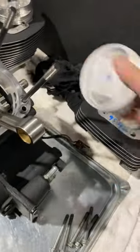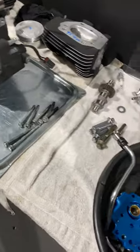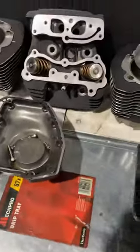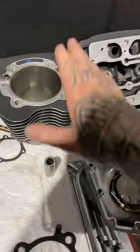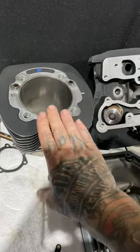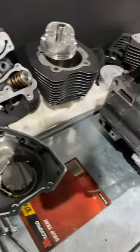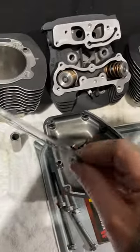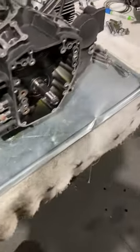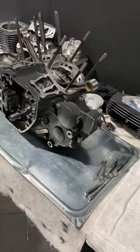So we've got to work out a true compression allowance. The cams aren't the typical 267s that come out of it, so we've got to work in with a camshaft combo to figure out what goes on. I've done a piston-to-deck-height check and we are at zero, which is great — so we can work off squish volume from here. Then we can move into compression with the pistons, head gasket thickness, and CC'ing the heads to work out exactly where we're going — pump fuel allowance obviously. We don't want things detonating and carrying on.